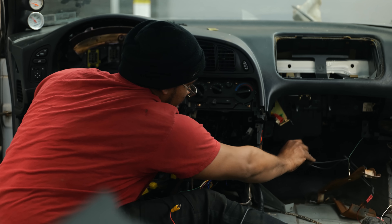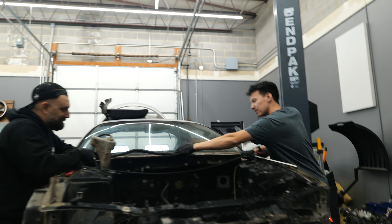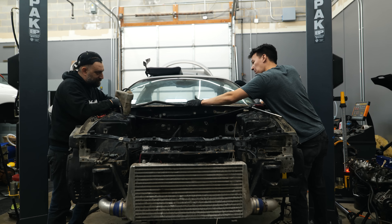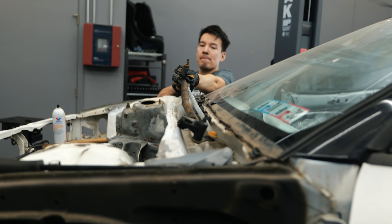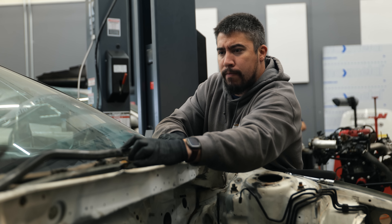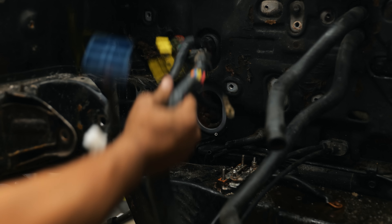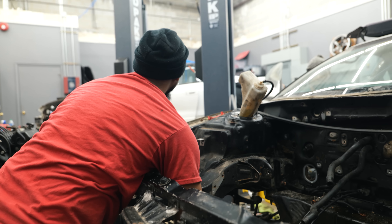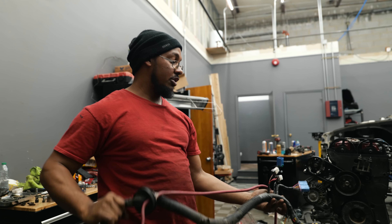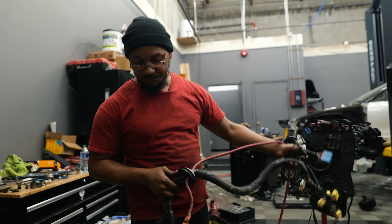Kenny and Chris were also losing patience with the sorry state of my Eclipse and with the previous owner's upgrades. This is the engine harness, and your yellow connectors are what connect it to the ECU — so this is easy to identify. Feed all of this stuff through the grommet into the cab, lay this over the fender, and everything plugs right in. It's real simple.